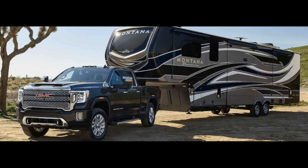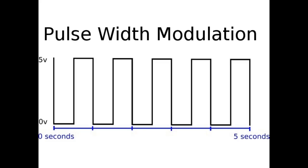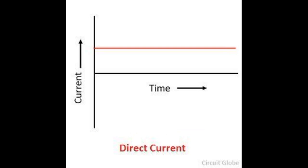The little blue lights on the cameras almost seemed to be flickering, and there was a buzzing noise coming from each of the cameras. As it turns out, the new model year trucks now utilize a PWM signal instead of a constant 12-volt signal for all the peripheral lighting on the truck, as well as any lighting on a connected trailer. I'm not sure why they've designed these circuits this way, probably trying to save power somehow, but regardless, that was the problem with these cameras not working.